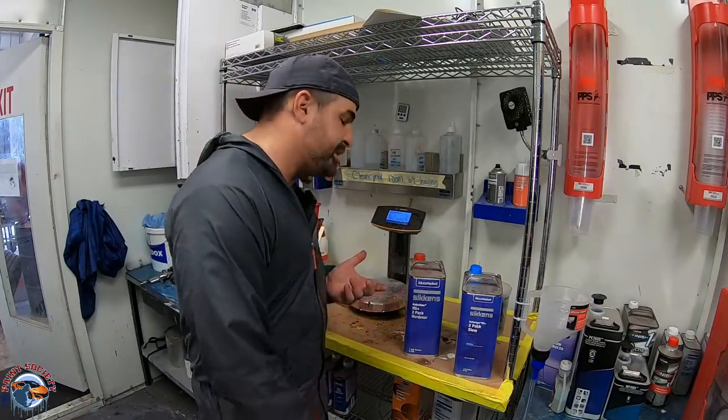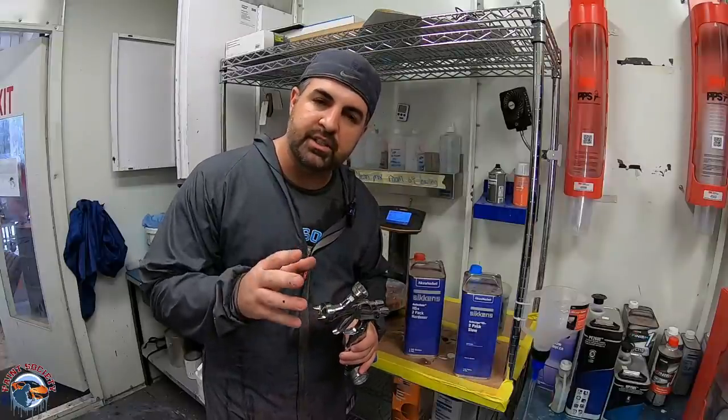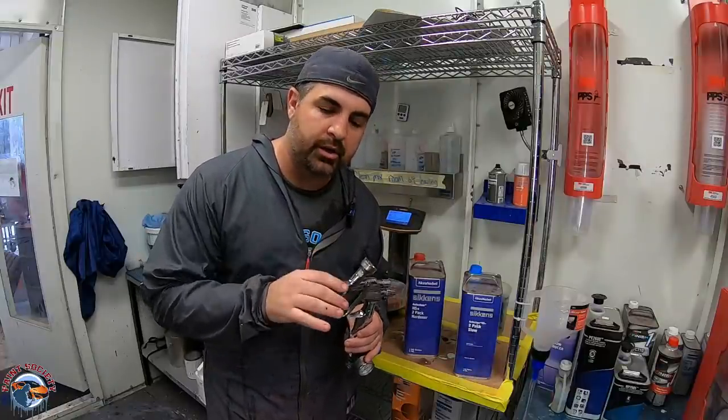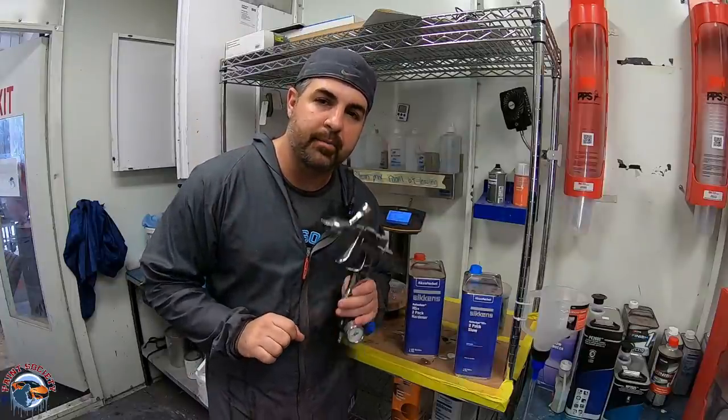So our base is all dry like we just saw. Now we're ready to spray our clear coat finish. And we're going to apply according to technical data sheets, but 1.3, we'll be using a WS400. And since our sealer, base are smooth, our clear coat's going to lay even smoother and absolutely stunning and beautiful.